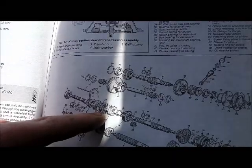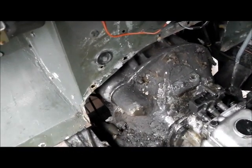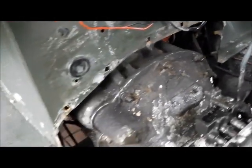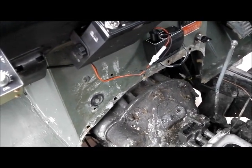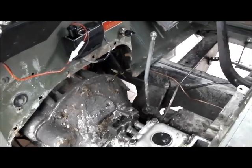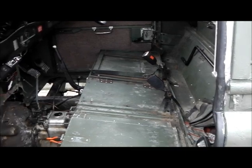Really, having done all the work, I might as well replace it with an overhauled unit. Just taking the very front piece off the transmission tunnel - it should have little plastic clips, but someone's put a nut behind each one, so I had a devil's own job getting all of that off. I'll have to get the proper fittings to put it back, or make these round and put a riv-nut in - that's probably a good compromise. So the seat box is ready to lift out, just need to get ourselves a gearbox.